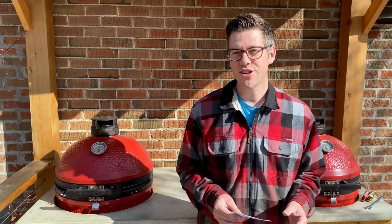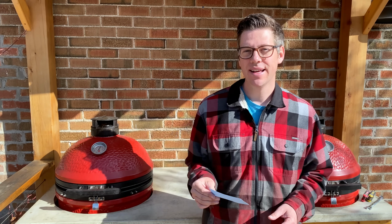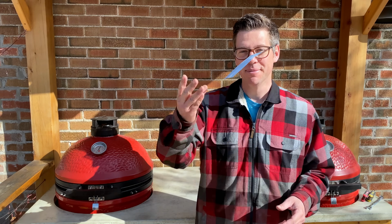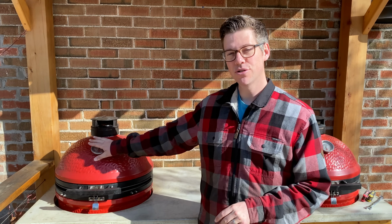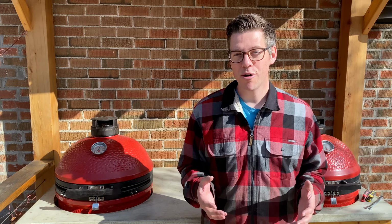All right, and just like that, we are at the end of another video and we're on to our last question, which is, my temp gauge is not working properly. So first, this is even easier to fix than anything else that we've done. All you have to do is unscrew the nut on the back of your temperature dial, take it inside, get a pot of water boiling.